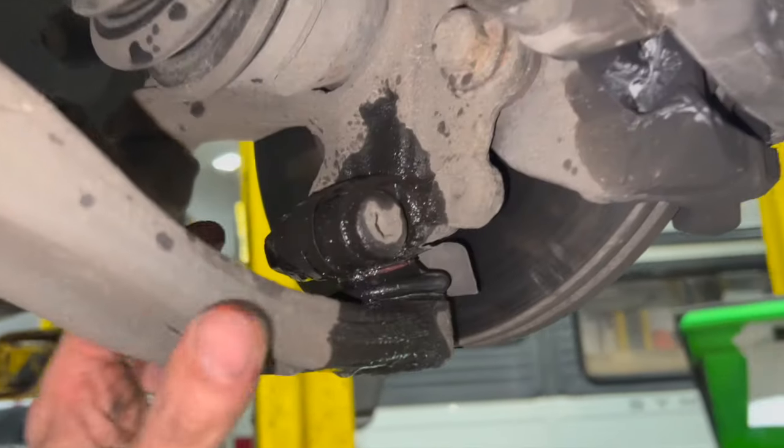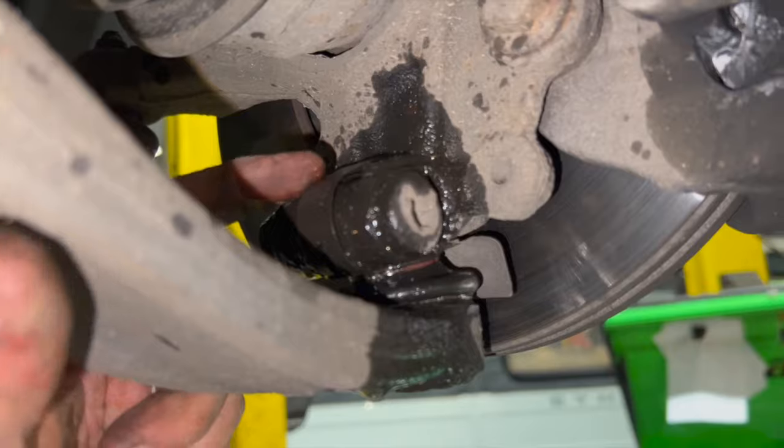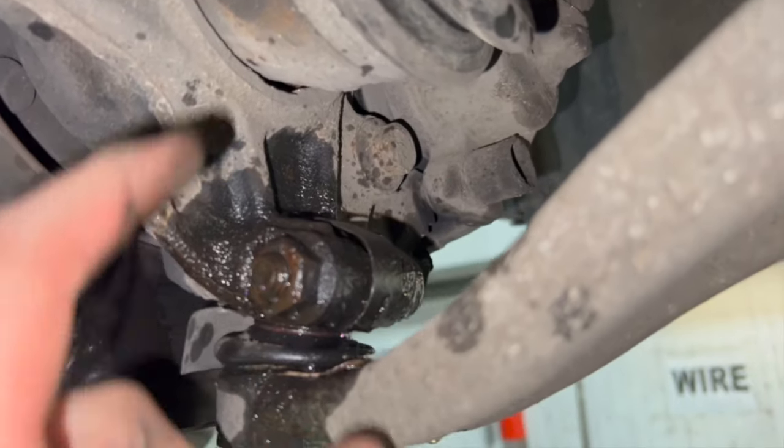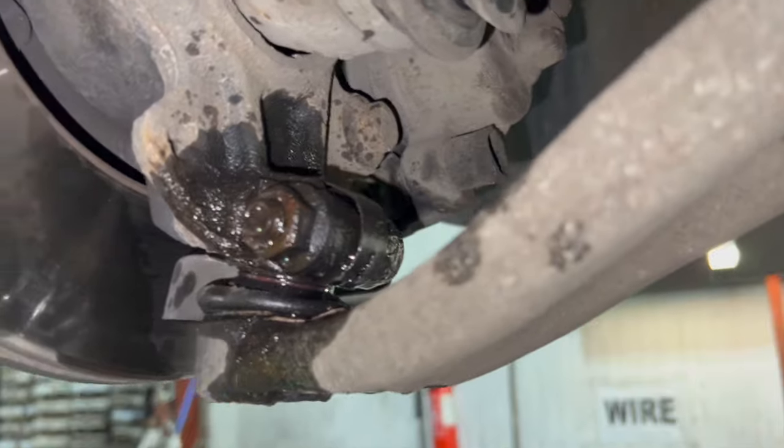I'm just going to now slacken, while I lube them bolts up a little bit there, I just put some penetrating oil around the ball joint as well. Just clean the threads up on there. These don't look pretty good, but they don't come off too bad normally, but it's always worth just getting a bit on there, just trying to soak it around the ball joint. It can be a little bit tricky to get out.